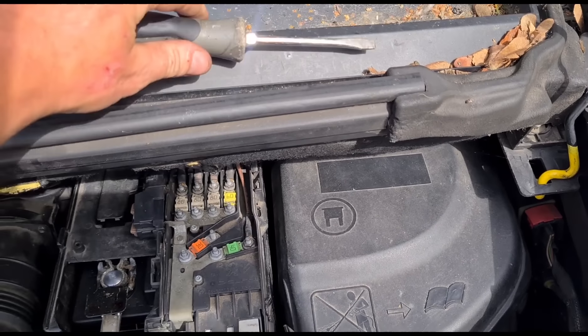There we go — the car started. We're probably going to have loads of errors pop up now. We'll use the EuroTab 3 from Launch UK here again and do the intelligent diagnose. I'll hit the high speed scan and let it go through all of the modules. You'll see what sort of faults we're getting — there's some braking system codes there. Not quite finished yet, we're nearly there.